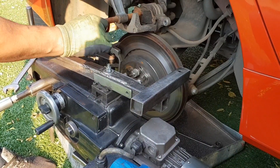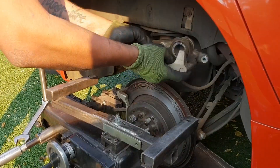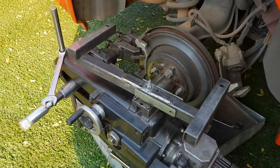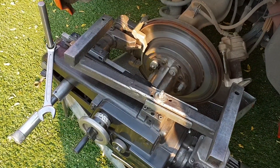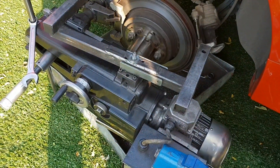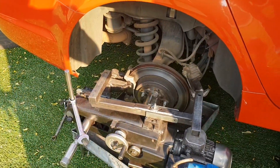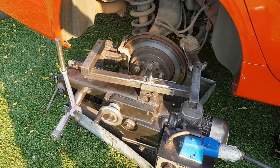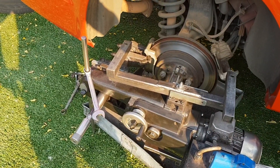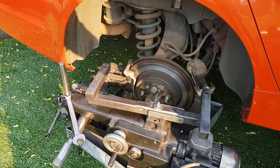That's the last one, taking the final cut. It's already pushing back the last piston as well. The machine is doing its job. He actually clocks this whole machine to the bodywork of the car. This last one was 0.02 mm — that's really very small. On a distance of almost a meter, let's say 800 mm, it makes it very accurate. So to see this machine going up and down on the vertical part is okay, but horizontally it is set perfectly.